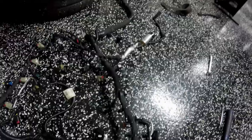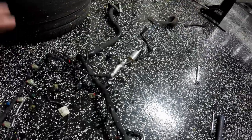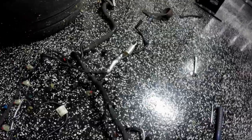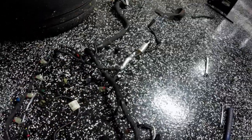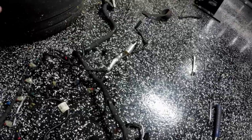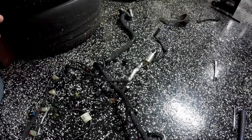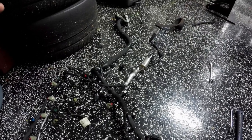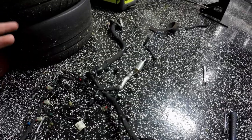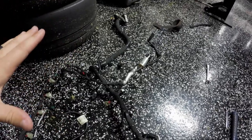After that experience — this being my second engine harness — I decided it was time to just buy another engine harness with no problems in it, put that on the car, and carry this one around as a spare in case anything goes wrong at the track. Obviously this isn't something I'd do between sessions since you have to remove the intake if the engine is in the car, but if you're on a trip it's actually not too bad — just a couple hours of work.